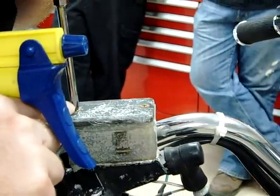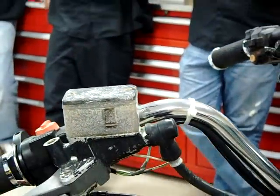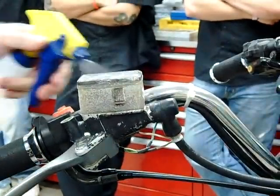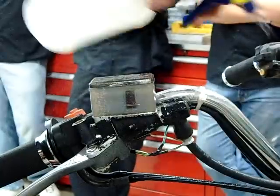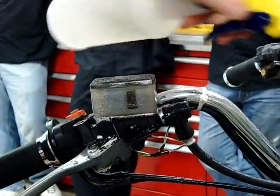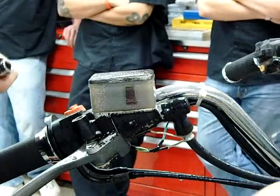There's a really good chance this is going to break and strip off. So instead of just continuing to force it around, I want a hammering action. I might get some fluid leaking out, so we're going to take soapy water, shake it up good, and just saturate this entire area.